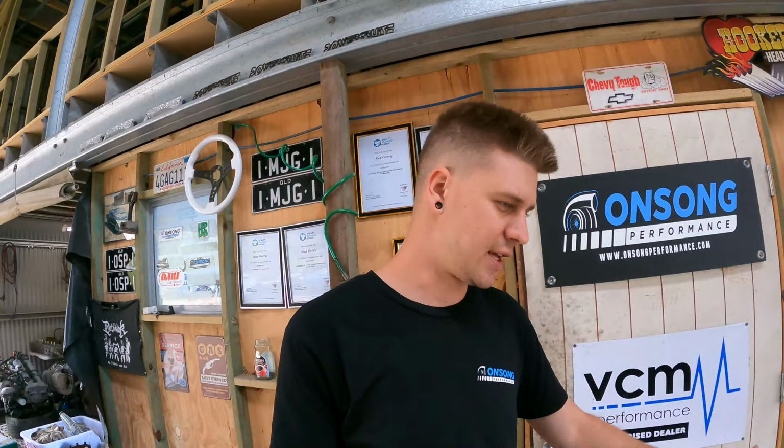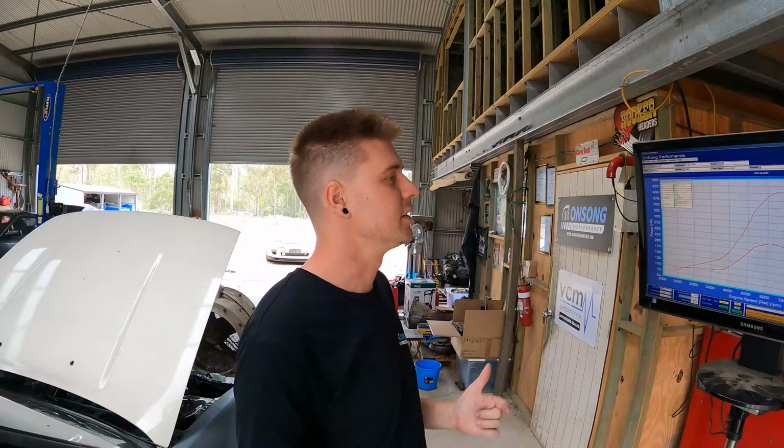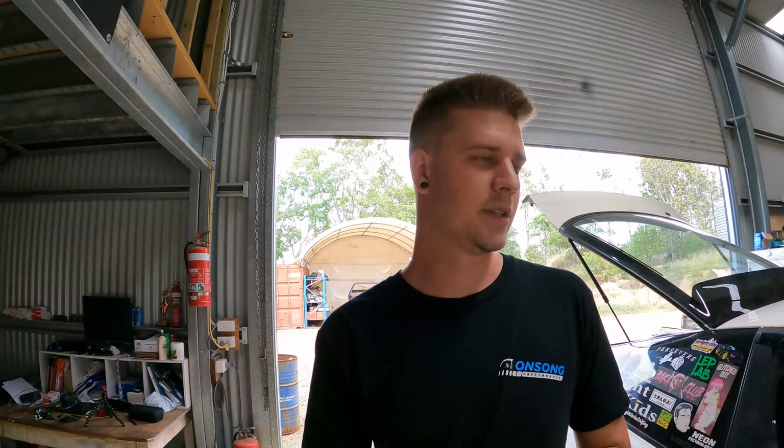And instead of making two really short videos, I decided to jam this in with the Supra. So the Supra, as you saw, we made 570. And the last thing we found out was that we're actually out of road speed on the dyno. So when I get that back on the rollers with the new coil packs in it, I'm gonna actually dyno it in fourth, just to make sure we've got that last few hundred RPM spot on as well. Don't wanna leave that on the table. And then the Supra will be done as well. So that's these two cars sorted.